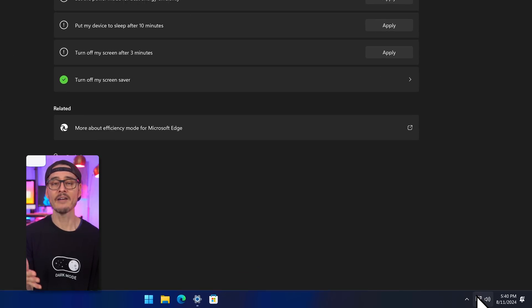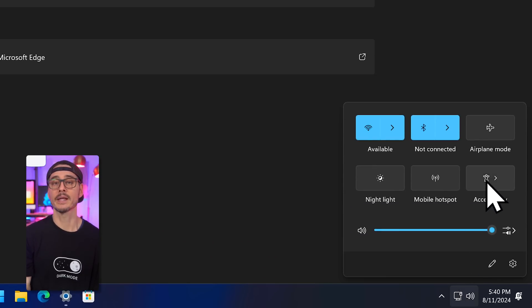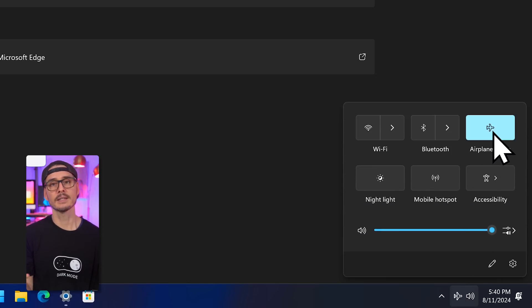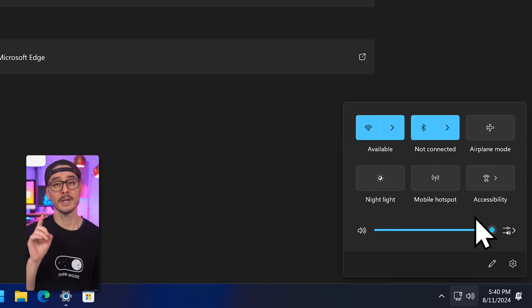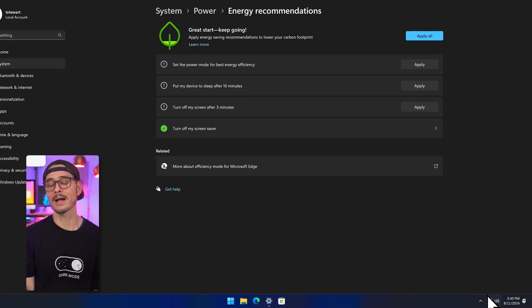Windows has quite a few ways to manage power for all of our devices. Before diving into traditional power management, let's start by disabling some devices. If your motherboard has Bluetooth, Wi-Fi, and possibly NFC, and you don't ever plan on using them, you can easily disable all of them by simply turning on airplane mode. You can also turn these off in UEFI or BIOS settings, but doing it in Windows makes it easier to toggle them back on if you need them. I'd also recommend unplugging any USB devices that aren't being used.